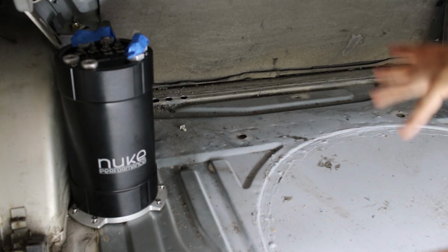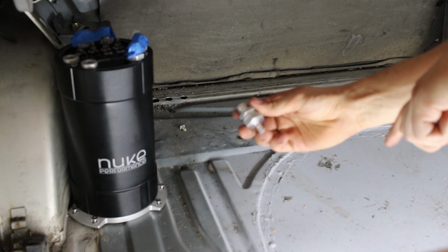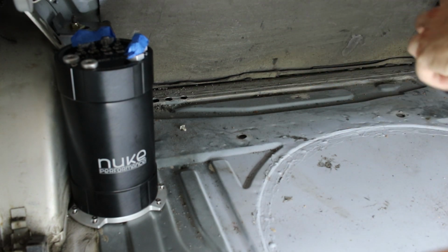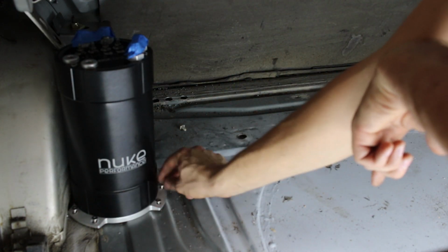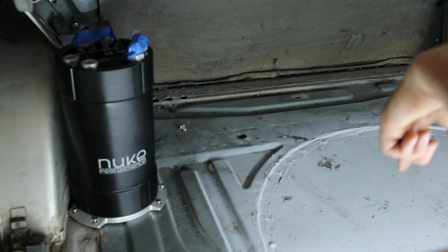We are looking good. Got my nice large holes drilled for my bulkhead fittings to go from the rubber fuel line to AN, and then to fit my whole AN line through. This is where the tank will be mounted. All the holes line up good on the bracket. Bolts are hand threaded in there, a couple turns. Hood, or the trunk closes.